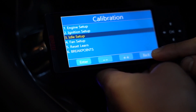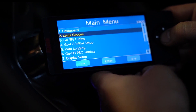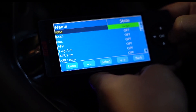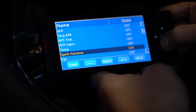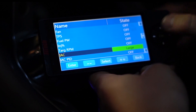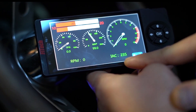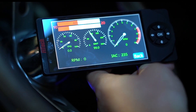We'll go back to the main menu so we can see how we're going to adjust the throttle adjustment screw. We'll go into large gauges. We'll turn on RPM because we know we're going to target 780 RPM, and then we'll find IAC, the idle air control motor. We'll go enter. We've got our RPM down at the bottom and our IAC steps.